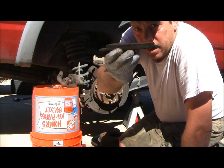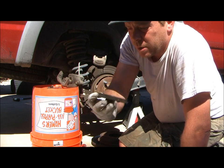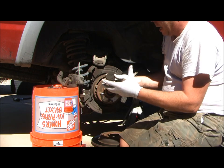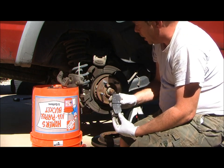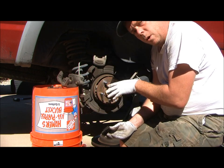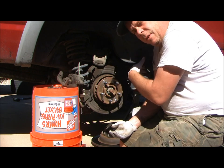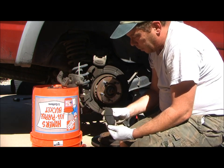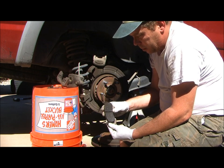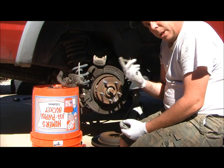If you look at the grooves on that, you'll see the groove is still really deep. I put these on two years ago, and it looks like the pads have worn very minimally since then. Rear brakes always wear at a slower rate than front brakes because most modern braking systems are roughly 75% front, 25% rear. So these are in fairly good shape. Let me go get the parts.